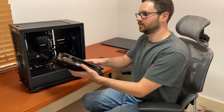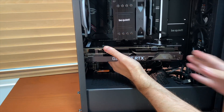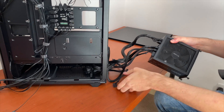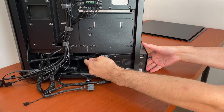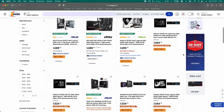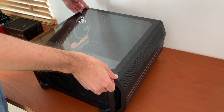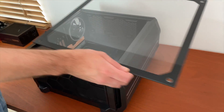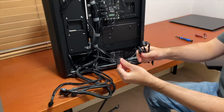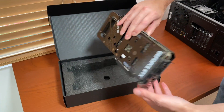X670 is a strange option. I don't see it becoming popular because it is a kind of high-end chipset made for people who want to build a workstation-slash-gaming PC and need more fast USB ports, as well as SATA and M.2 for storage expansion. But X670 does not make much sense because it does not have PCIe 5.0 slots for graphics cards, while costing almost the same as X670E motherboards that come with PCIe 5.0 support for up to two graphics cards. So if you are shopping for a high-end motherboard at close to $300 or more, I recommend skipping X670 completely and going straight to X670E — that way you don't need to worry about compatibility of future graphics cards for many years in advance.